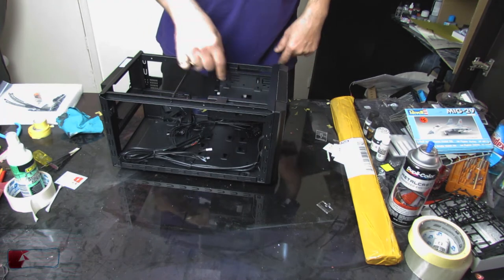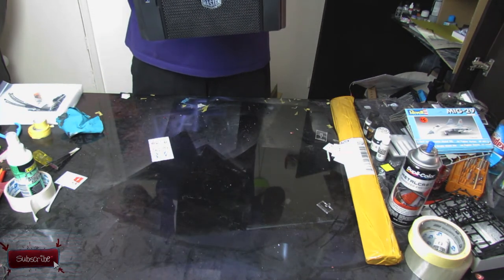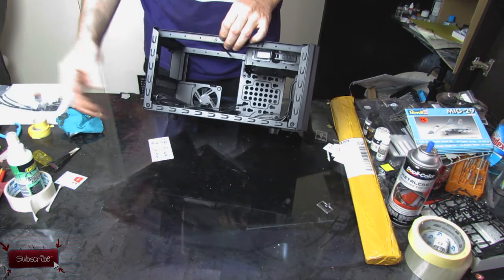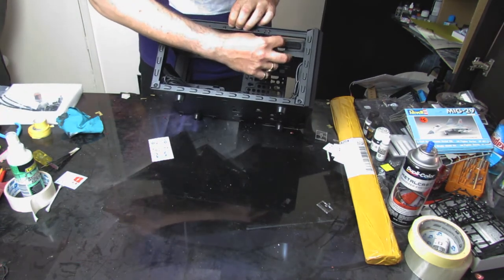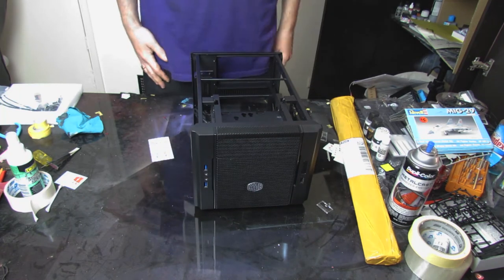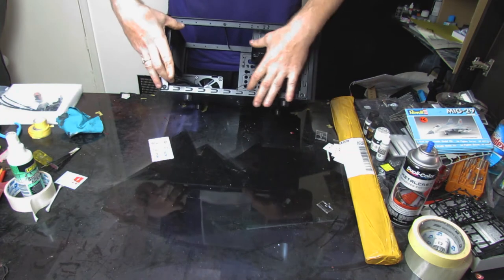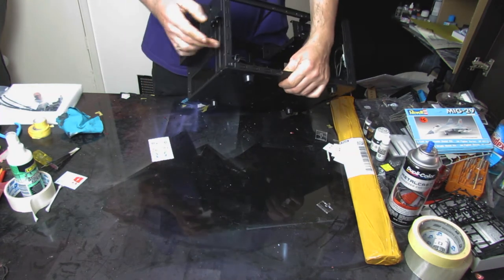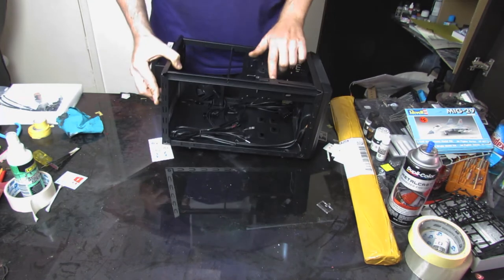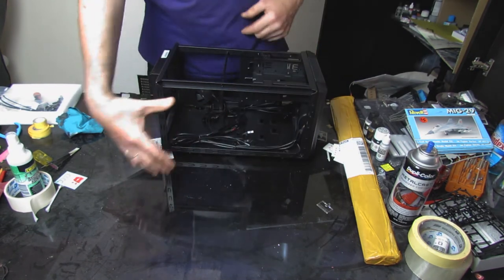The five and a quarter bay is used for mounting other hard drives. You can take SSDs - there are SSD mounts with little rubber clips that go in down the bottom. There's not a lot to it but it can still hold a mini ITX motherboard, and all that space there is available for the graphics card. You can fit a two-slot graphics card, and you can even just take that bay out so basically any graphics card is going to fit across there.